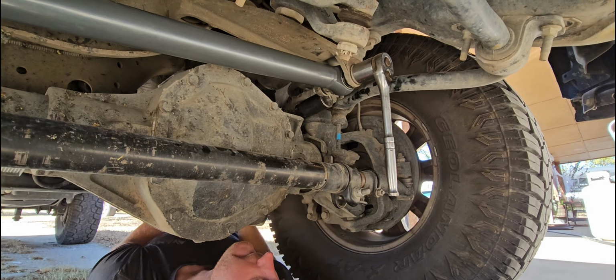So I am at, to my outside lug, 22 inches and an eighth or so. I'll go out here. Yeah, about 22 inches and maybe 3/16 to an eighth, kind of in the center of that. These lugs are offset, but 22 inches and roughly in the center of 3/16 and an eighth. So we're going 22, 3/16 and an eighth.